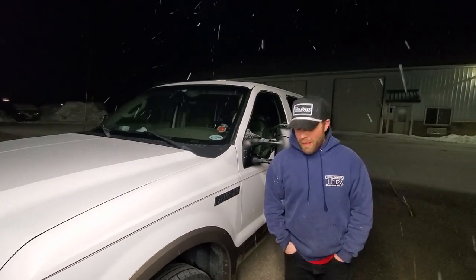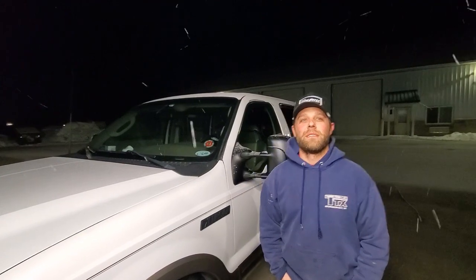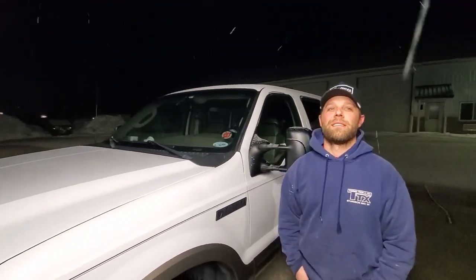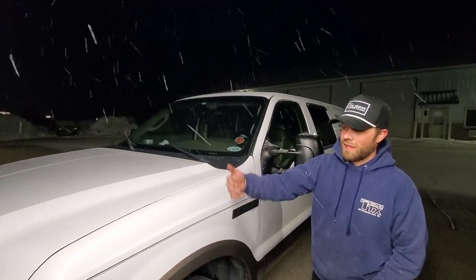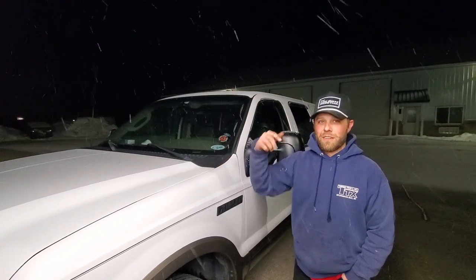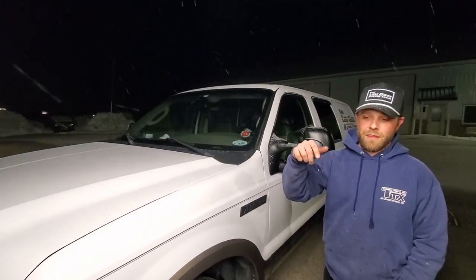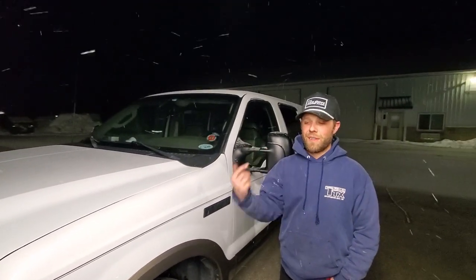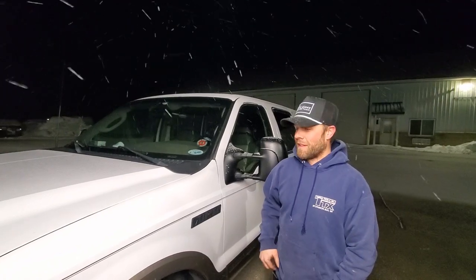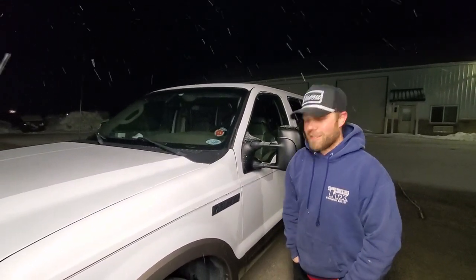And he decided he wanted to do that, and it was up until 3 a.m. doing that. Oh my god. Yeah, but it was good. It went along good. I was trying to take some videos and take my time, making sure the cylinder's cleaned out really well. And if you'll notice in the videos, I put the heavy grease in the flutes of the tap and of the reamer, really keeping those chips out of the cylinder. And I mean, it seems like it's a foolproof fix. You just gotta suck it up.